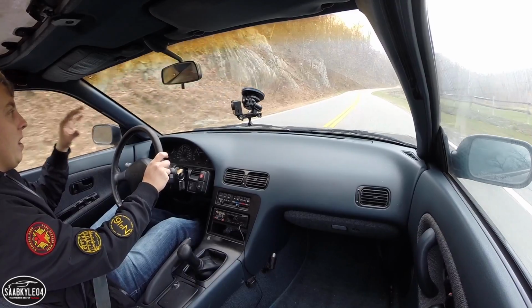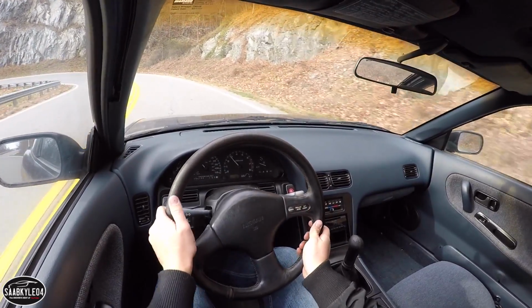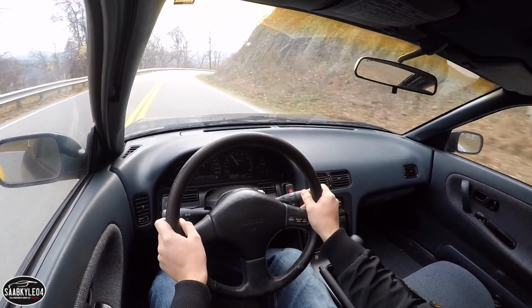and I want it to stop, and most of the braking power is going to be with the front anyway, so I don't see a point in really beefing up the rear aside from pads and just changing out the discs for better cooling. Suspension is another thing that I'm trying to figure out as well. I definitely want to drop the car.